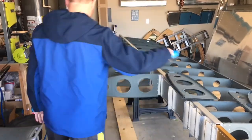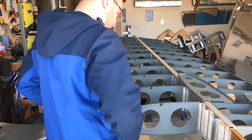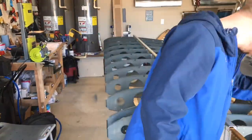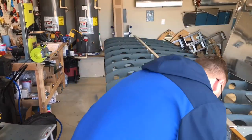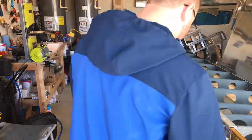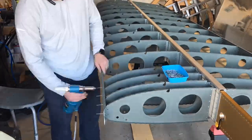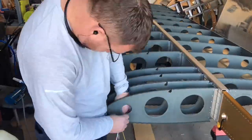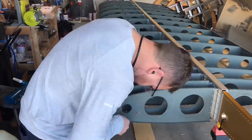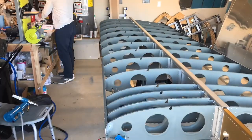It's worked great for me on the RV-12. I did use AKZO on the RV-10 project and I love that stuff. The rattle cans do get expensive, so if you're going to be priming pretty much all of your components, I recommend buying AKZO — or your preference of primer — in gallon-size quantity. It's going to be a lot cheaper in the long run. I've gone through about a dozen rattle cans just on the wings alone, running five or six bucks a can. A couple gallons of good aviation primer at $100–$200 is probably better if you plan on priming everything.